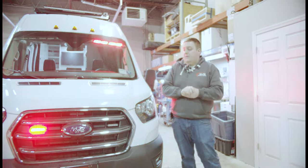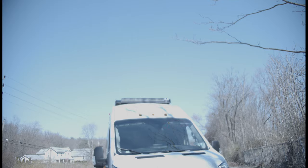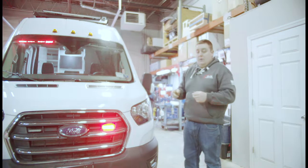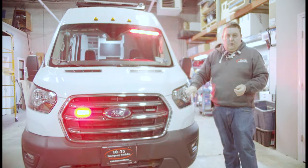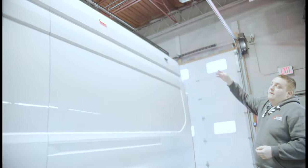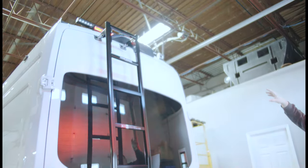Taking a look at the outside front of the vehicle — Ford Transit platform. The front of our roof rack has our FireTech brow light and another camera. The front windshield has a custom-made four-module M-Power shroud kit; nothing's made for the Transit so we had to adapt it. White override, white flashing, headlight flasher on park kill, M-Powers in the grill with white override, three M-Powers across the top on wedges, and another M-Power below — all with white override. The side of the roof rack has our FireTech brow light with another camera, and the arrow sticks in red flashing mode with a white reverse and amber arrow feature.